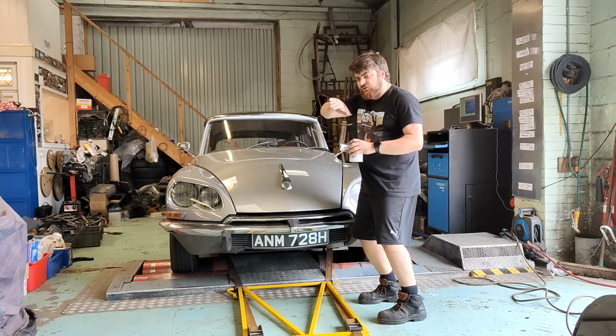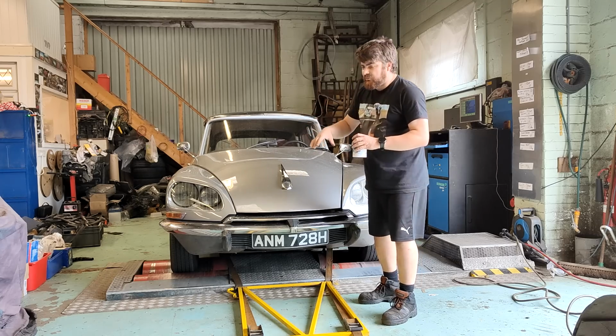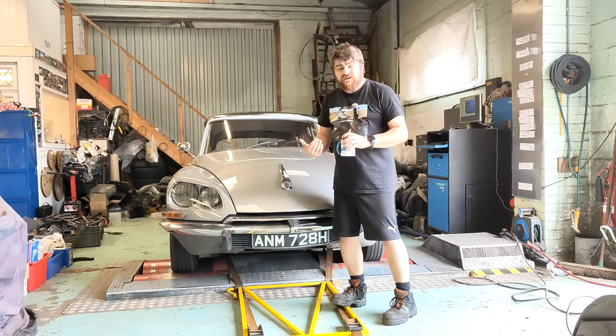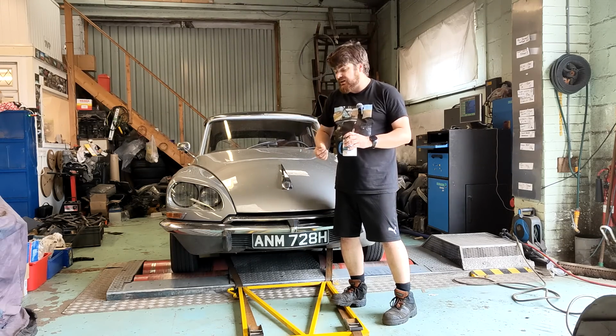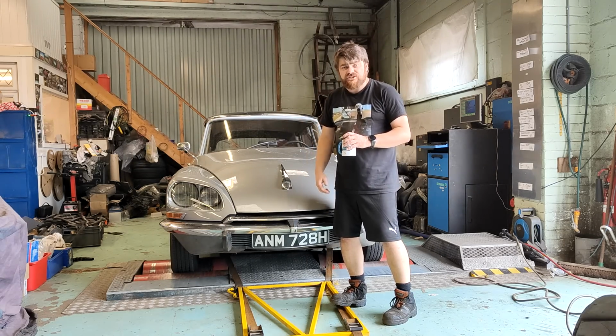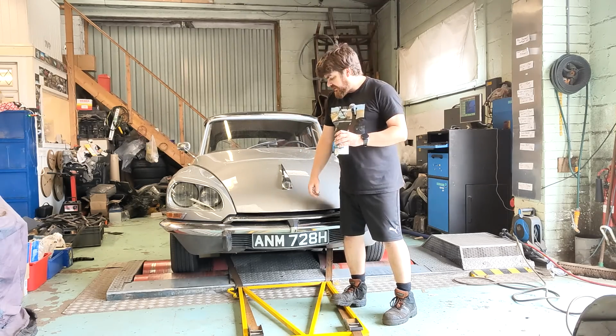What I want to see is that it's got a nice curve, because then that suggests that all the fueling and everything is tickety-boo. The problem it had when I went out last night, it seemed to run out of fuel, basically. It was a long, sustained run at 50 miles an hour on the road, and it just got fuel starvation. Cut out, conked on the side of the road, turn it off, wait a bit, and it got going again.